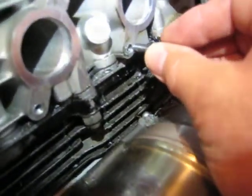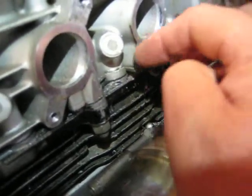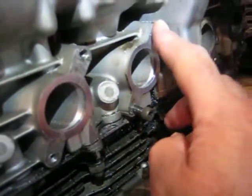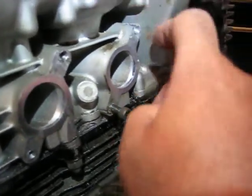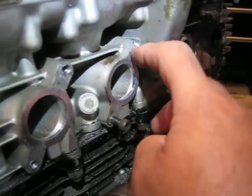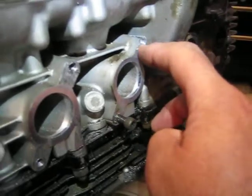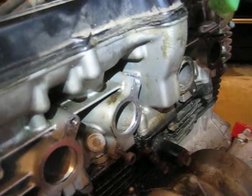I think what I might do — you'll notice the holes down here — is replace the manifold, put it up here, find out where exactly that hole is because I think I was a little high. And drill it a little lower this time. Then afterwards put in a helicoil and after that get some JB Weld and fill it up over the top of the helicoil. Hopefully with the JB Weld I won't have to get it out to get welded. It's aluminum — so stinking easy to break — and I broke it obviously.